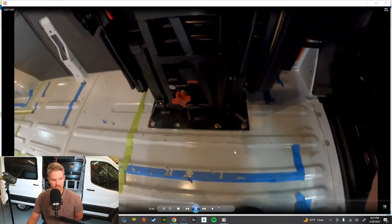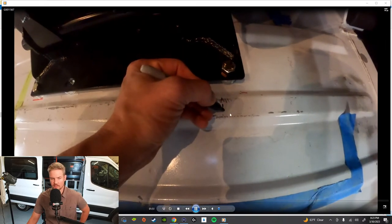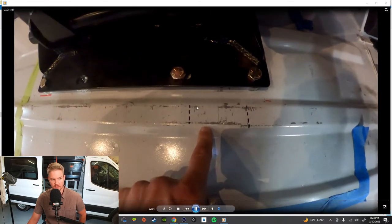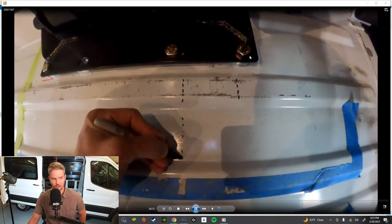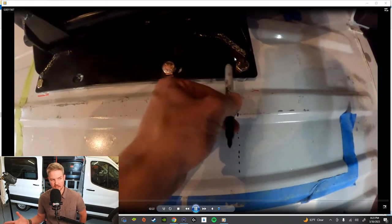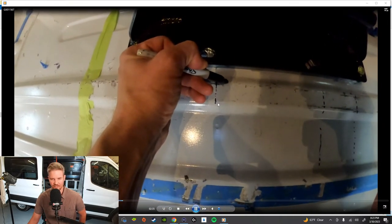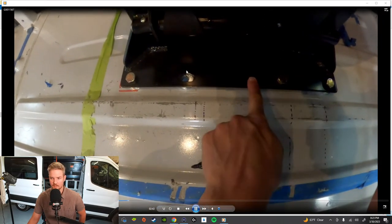This next one we're going to show you how this plate is laid out. I'm drawing from behind this front bolt — there's a cross member. I'm basically just drawing a dash line to show you the beginning of the cross member. That cross member goes from here all the way back to here, so these two nuts straddle that cross member. We're actually going to go underneath the van and show you what it looks like. You've got this beam going through here, so really you can't go forward or back — that is where you're going. You can only go left to right.